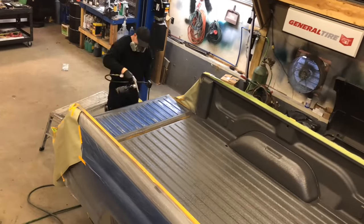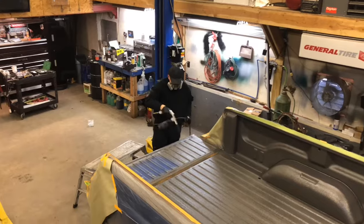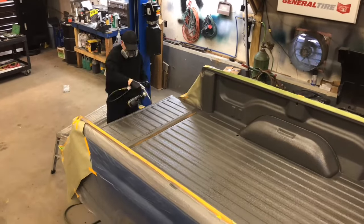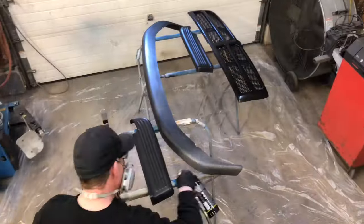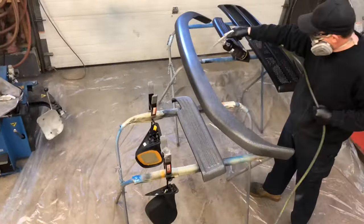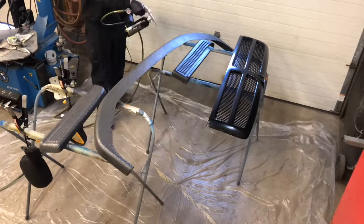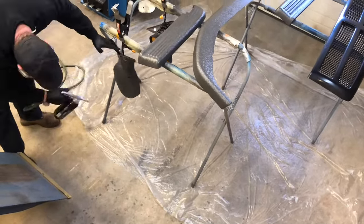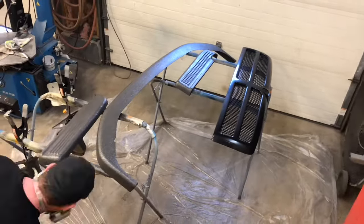As I'm spraying, I'm looking at my coverage — if it looks a little lighter or darker, I'll adjust as I go. The two options when spraying are one coat, which has to be heavier, or two coats. If you have the time, two coats is best. Do a heavy first coat at about 70% coverage, then a lighter dust coat second. Follow a similar pattern for the second coat but stay a little farther from the panel, letting the material lay over more evenly for a nice uniform surface. This project I only did one coat, and I'll show you at the end what it looked like. For small pieces, coverage is more important than pattern — take your time, get good even coverage, don't rush. That's the key to this.